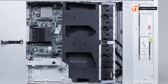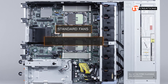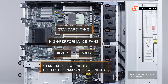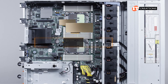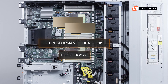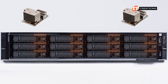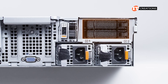As an air-cooled server, there are three different fan configurations: standard fans, high-performance fans, and either silver or gold. Also standard and high-performance heat sinks depending on the configuration. If installing GPUs, you will need high-performance heat sinks for CPUs with a TDP greater than 185 watts. You'll also need those high-performance heat sinks with storage configurations with 12 3.5-inch storage bays, and if you add the rear storage module.